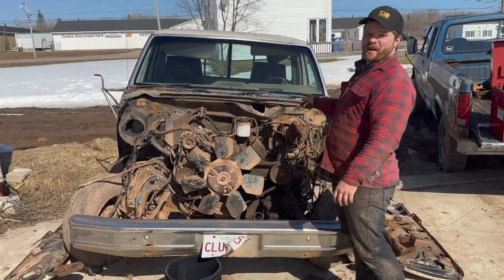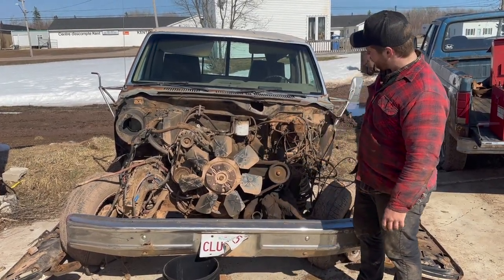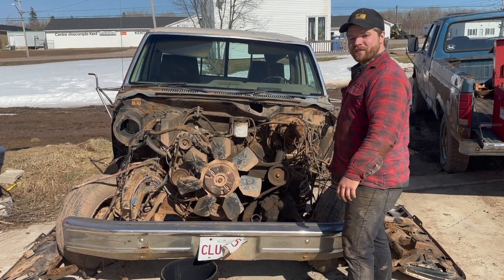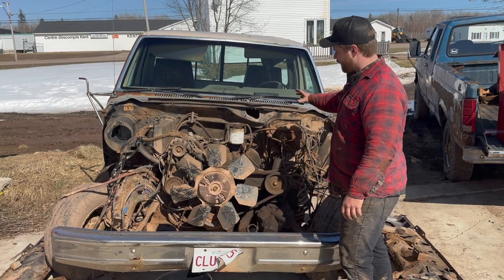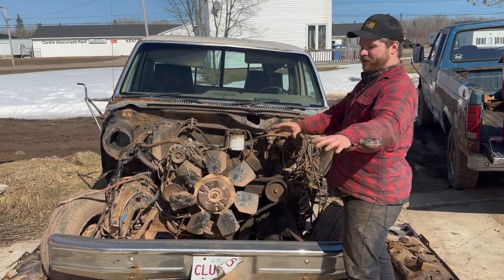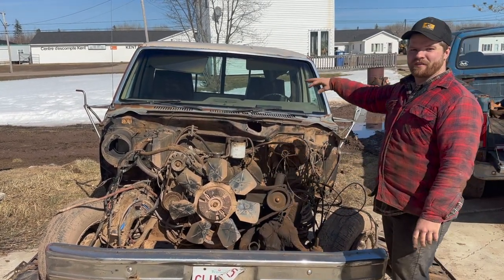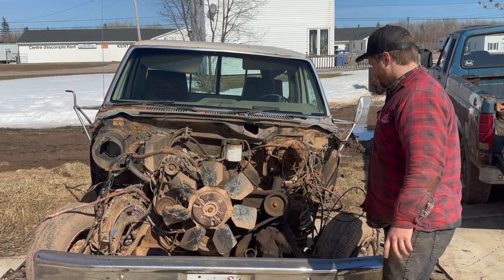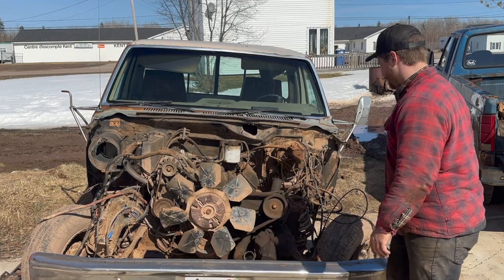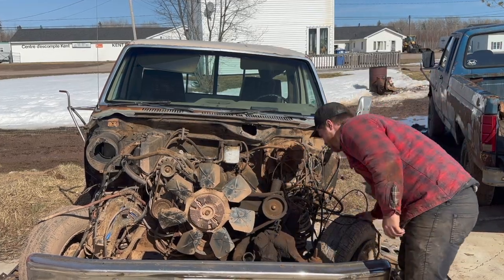Awesome. Now what we got to do, we got to unbolt the transmission cross member on both sides. Might even have to just cut him off and then unbolt the drive shaft, unbolt our motor mounts, and then we should be able to lift the whole thing, scoot it out. Oh, sorry, and take off the shifter housing on the top. Not a big deal. So that's what we're going to start working on. First, I'm going to see if I can get inside on those motor mounts there and rip those guys off.